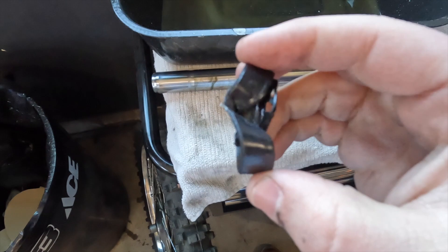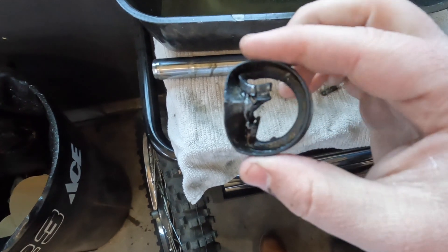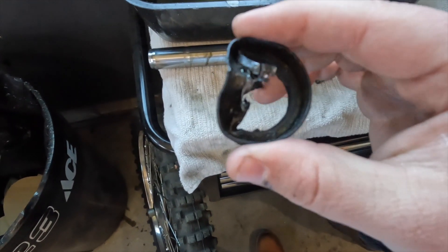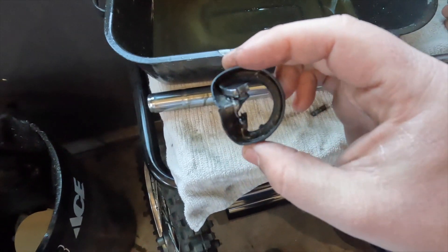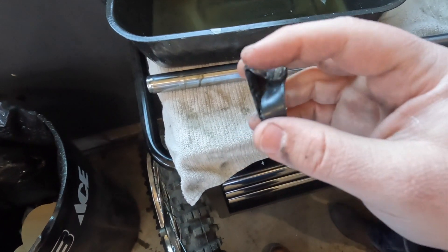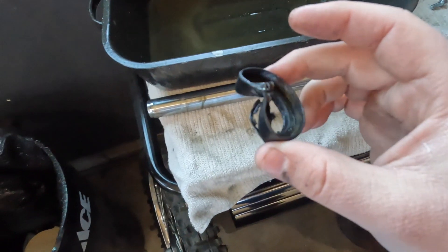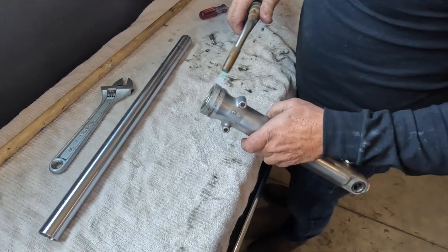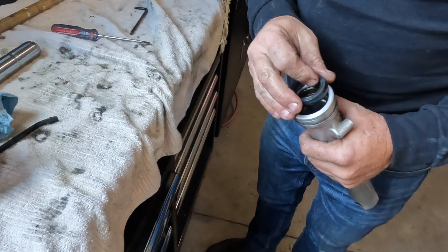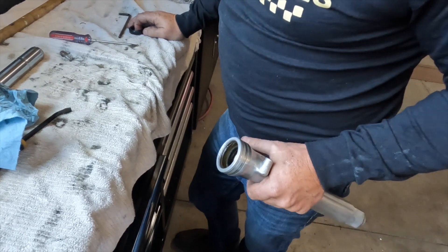Let's put these forks back together and get this bike back. So this is what that second seal looked like after we pulled it out. It's really strange — it's metal, not pure rubber, which makes me think it was probably just a badly engineered 1970s part before things got better. Once we pulled the normal seal out and this one, the new seal fit just fine. So I don't think this is a necessary part that's supposed to stay in the fork leg — it won't fit with that rubber in there.